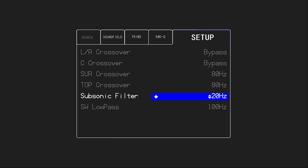We also have a subsonic filter option — if you didn't want the subwoofer playing below 20 Hz for room response reasons, you can set it to cut off below 20 Hz. Or if you just want all that bass to naturally roll off where the sub rolls off, you can set the subsonic filter to off. Another interesting feature is the subwoofer low pass setting, which determines where to start sending information to the subwoofer. You'll notice that you cannot set this any lower than the highest crossover point of any of your main bed or surround channels.